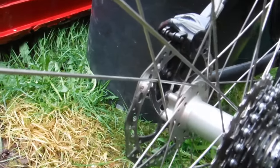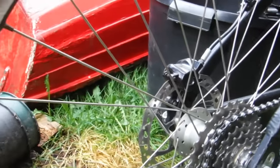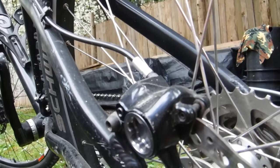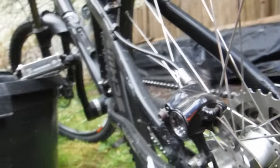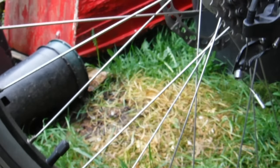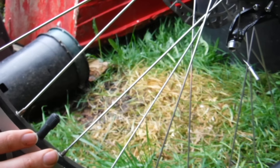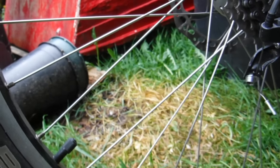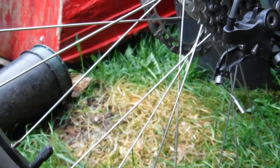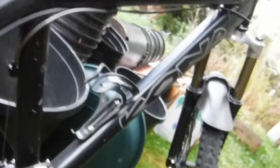The rear hub is a simple Formula cartridge bearing with a 160 rotor. The Magura has a built-in IS mount — no adapter needed, nice and light but very stiff. People even use these on trials bikes. The rim is a Rhyno Lite, which is capable of running a rim brake, which makes it look a little cluttered, but it's still anodized — I could paint it black, but for now I'm happy with it.